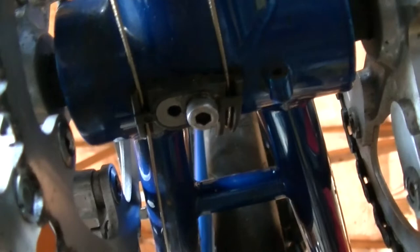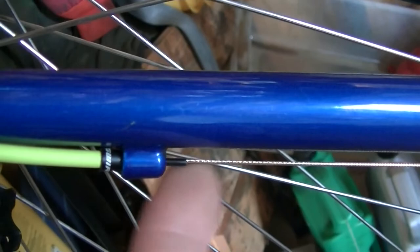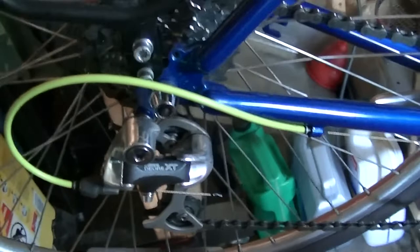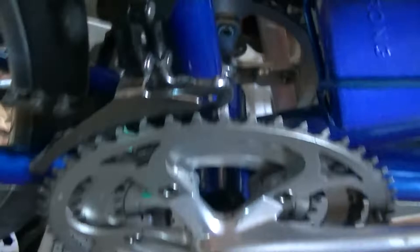Moving on, let's get back up off the floor. Here we have another one of those caps that has the thin piece. And then you have the cable. I decided I'd like to cut my cable length, and right here would be a sealed end cap that goes into the derailleur. They include a pre-finished one in the kit — I just didn't like how it seemed too short to really bend around and reach, so I elected to cut my own and it works out great. That is the rear derailleur, and the front is very much the same, other than you really only use one piece of cable and then all of the accessories.